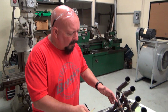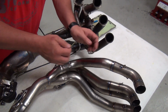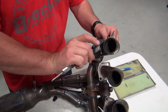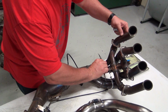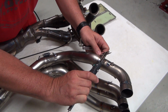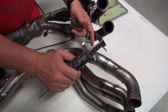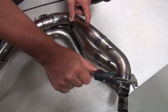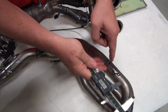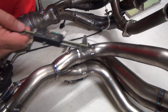So when it comes to configuring that, we have different diameters here. Now this diameter is, if you go over here to the stock system, we've got 1.5" head pipes all the way down. There's no steps. You come over here to our Predator, it's 1.625, so 1 5/8" head pipes. They are tapered from up here, where we actually choke them down under 1.5 inches. Now that gives us sort of a megaphone effect here. And then we've got a step here in the tubing.